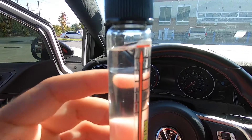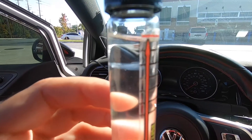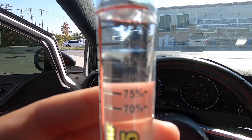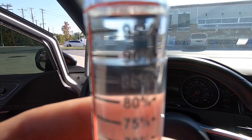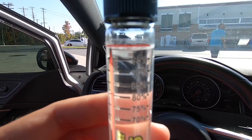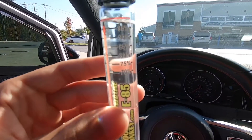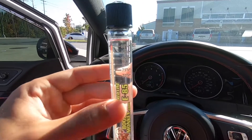As you can see, the separation between the two — the bottom section is the E85 mix. It looks like we're at about E88 or something like that, so it's pretty high. Very valuable tool to test exactly how much E85 is at any particular station. So now we know.